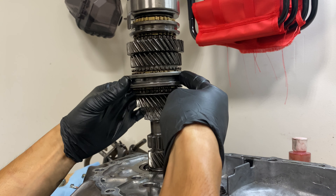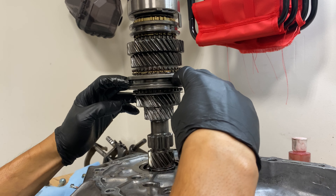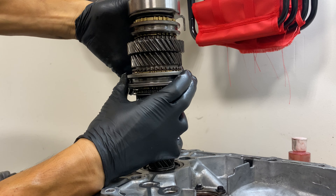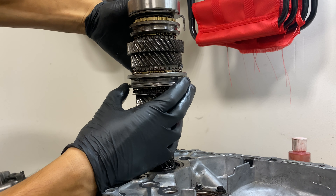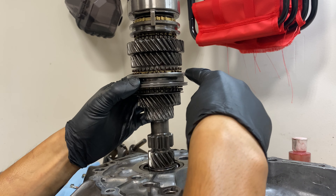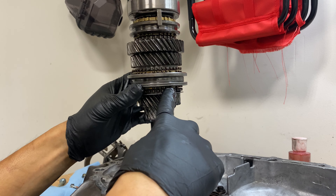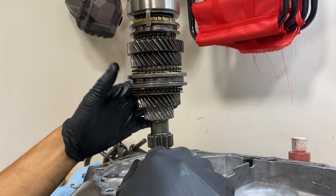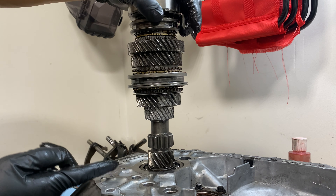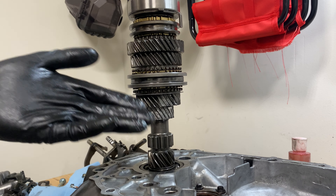How this works is this is the selector right here. So right now we're in neutral. If you go into third gear, you would just go down — that's third gear. Go back up, we're in neutral. Go all the way up — fourth gear. This is kind of gold or bronze, this really thin one, and right under it there's a gold or bronze one right there. Those are called synchros. It's not so intimidating now that I understand what's going on.